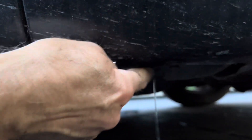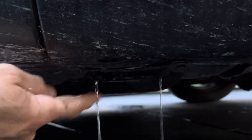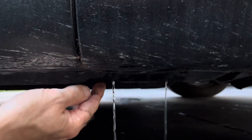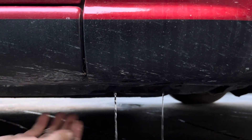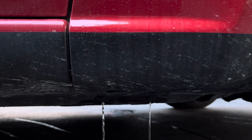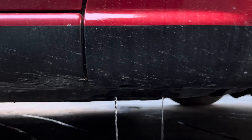Those are the rail drains on the bottom sill of the Mazda MX-5 Miata. It's the same from 1990 all the way to 2005, and that's what happens when they've been plugged for a long time and they get full of water. You'll hear a sloshing sound as you accelerate and brake as the water moves back and forth, and eventually this will rust out the rocker panels — that's the main reason why you see Miatas with very rusty rockers.